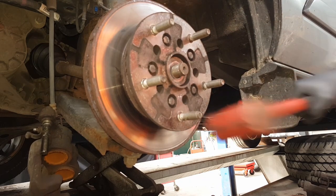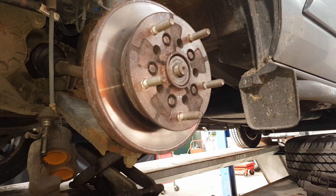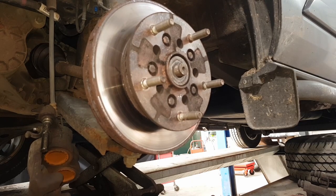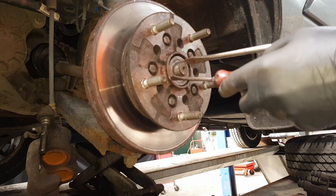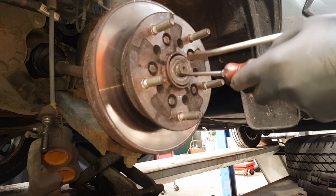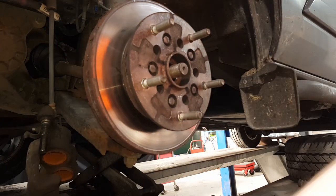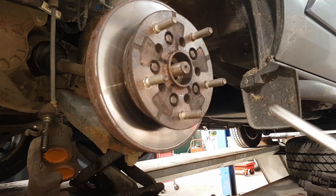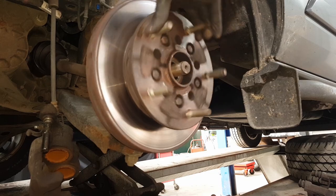Now take a soft hammer and knock the driveshaft loose - you can see it's now nice and loose in the hub. Once we unbolt the hub we need it to be loose, otherwise it'll be really awkward to get the hub off. Then remove the washer. It can be a bit awkward once you've tapped the shaft as it sometimes jumps out by itself.